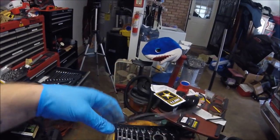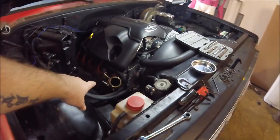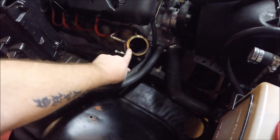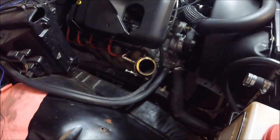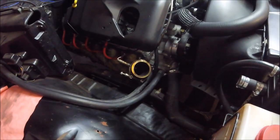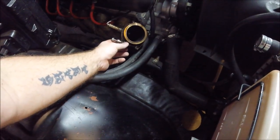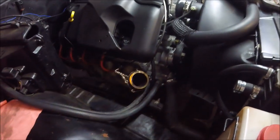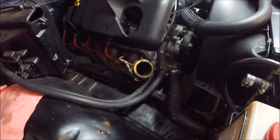We're going to put our multi-layer steel gaskets back in and start slapping this thing back together. Got our new gasket on this side and I'm about to put the crossover pipe back on. We're going to put a little bit of copper RTV on the v-bands here, hopefully they'll seal a little better this time. I don't think they're warped, but I'm thinking maybe these clamps have flared out inside from being taken off and on so many times, so they're not fully compressing the way they should.